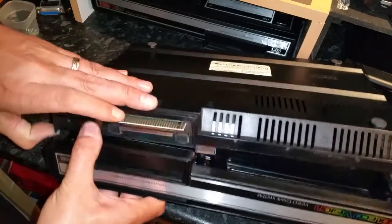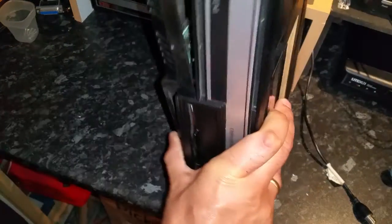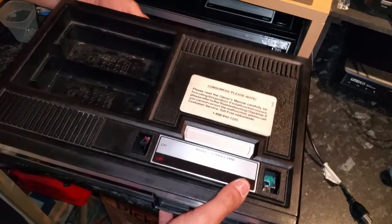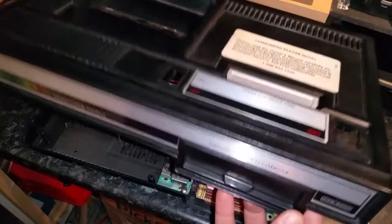The actual motherboard inside is attached to the bottom of the case. So once you have the two halves loose, you basically want to flip it back over and remove the top half of the case.